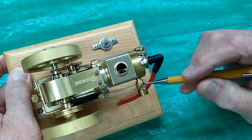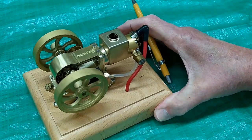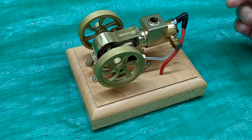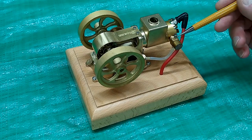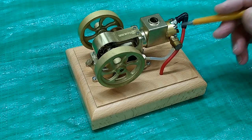I'll mark the needle valve setting with a sharpie as it was received from the factory. The speed of this engine will be determined strictly by needle valve adjustment. These tend to only run at one speed anyway — intake is limited by the size of this carburetor, so when you restrict the air or fuel that can get in, it can only run that fast.